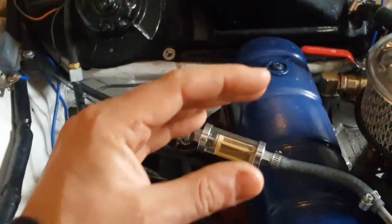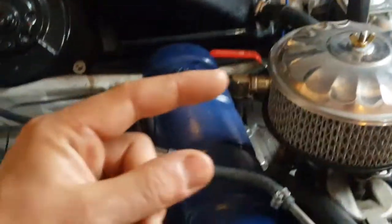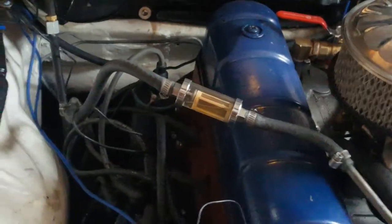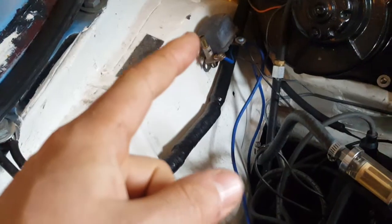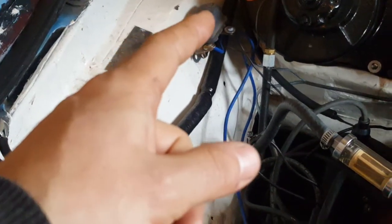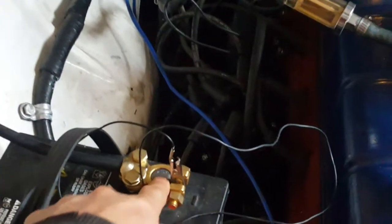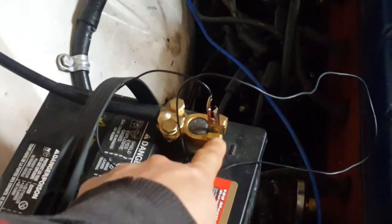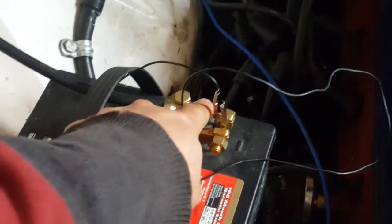So again, the electromagnet, like any other electrical component, needs the positive and the negative, so to speak. So the governor has to be isolated from the car. Now, if for whatever reason the governor isn't isolated from the car, then we should get a circuit or a light turning on if I put the light on positive, because again, it's supposed to be negative. But it should also not be connected to the positive or negative, because, like I said, it's completely isolated.